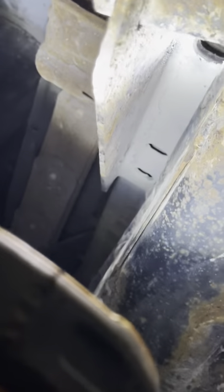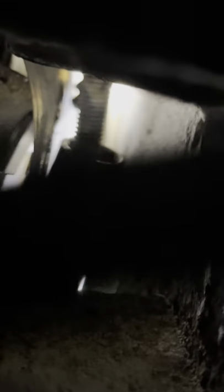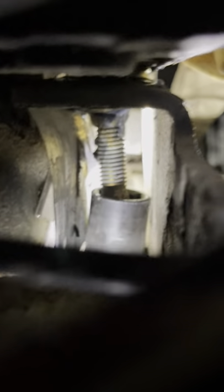I've removed all four of the bolts over on this side, and I just finished welding that bolt on. It's a grade 8 bolt welded on to the round head of the last security bolt holding the hitch on, and it's just about to come loose and fall to the ground. This will be two days of my life behind me. Then I'm just going to bolt the new one back up with some standard grade 8 bolts and washers, put some threadlock on them — high strength, heat required to remove — and hopefully I'll never have to do this again.